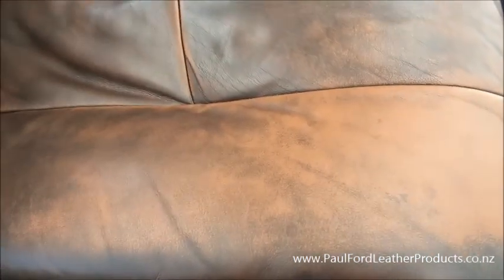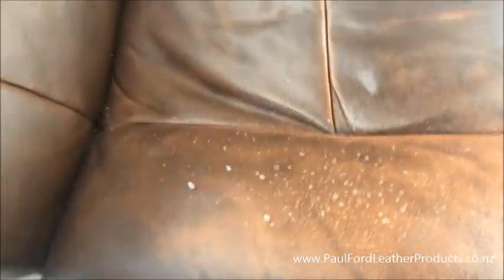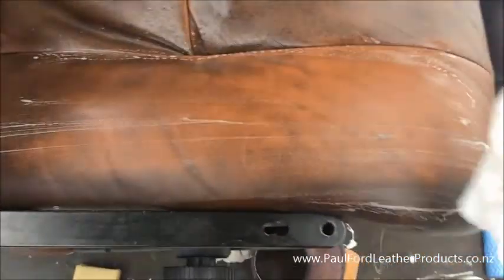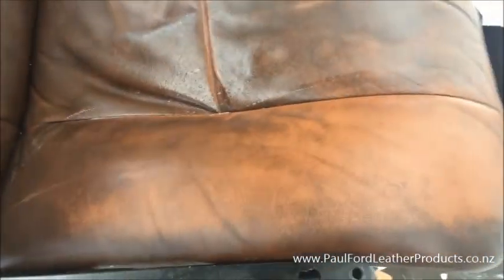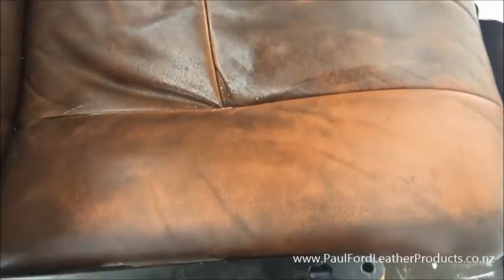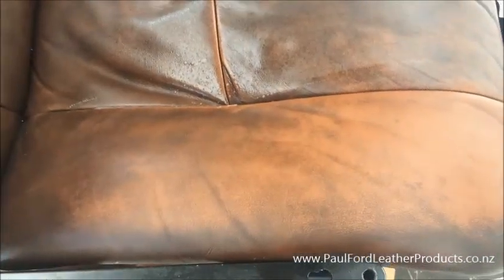The first thing I'm going to use is the leather cleaning brush. I'm just spraying a little bit of leather cleaner onto that panel there, and dipping the brush in the water, just giving it a very, very light going over. You can see it's sort of frothing up. Wipe it away with a microfiber cloth - I'm just using a paper towel here so you can see. There's a slight amount of print colour coming off there, but it hasn't moved anything at this stage. Just wipe it off and leave it - don't keep rubbing it, because as you rub it forces the liquid into the print colour and causes it to become sticky and it comes straight off.